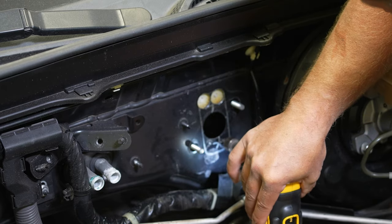So these clutch lines come with this mounting bracket on. It's designed to go on the tab. You can see there's a curve which directly matches the underside of this. So we're gonna put that under there, run a bolt through it, and tighten that up, and that'll locate this clutch bleeder line down where it needs to be.